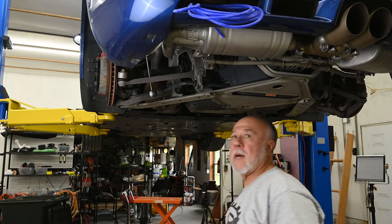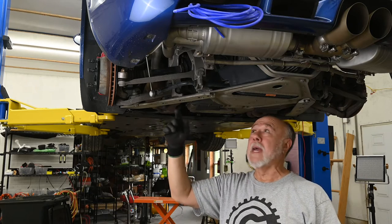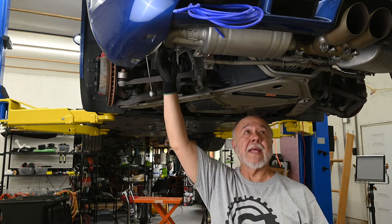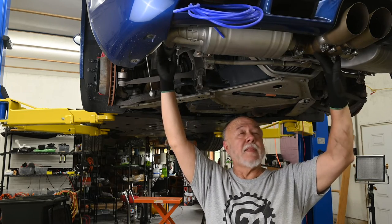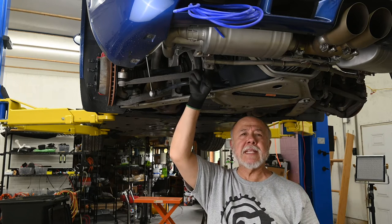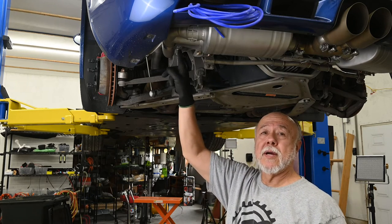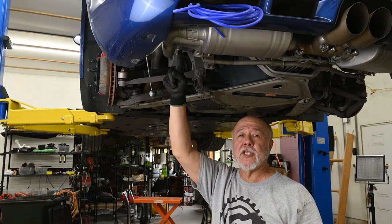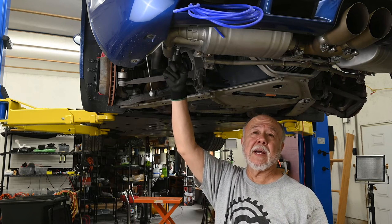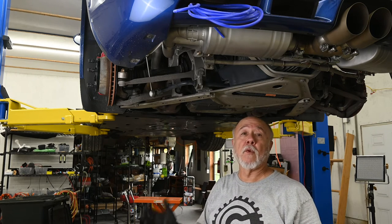Okay, so the last step after getting the clamps from hell on was to start at the exhaust flanges, tightening everything up: do the exhaust flanges, then the brackets and the clamp that holds the pipe to the bracket, and then you end with the exhaust tips. Be aware that there is a torque spec on this bracket of, I think, minimum 18 pounds. I tightened it far beyond that; 18 pounds just didn't seem like very much. And this clamp here is 40 foot pounds, which takes a long time to get to because there's a lot of pull up that happens in this thing. I ended up doing a lot of it with the impact driver, tightening it up pretty good, and then finishing off to 40 foot pounds with the torque wrench.